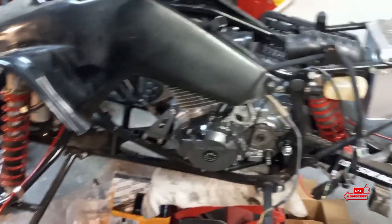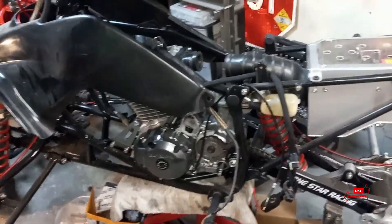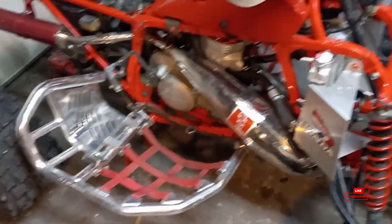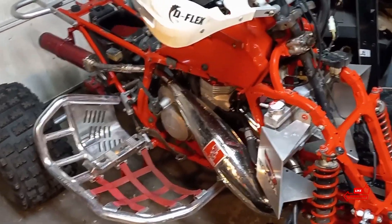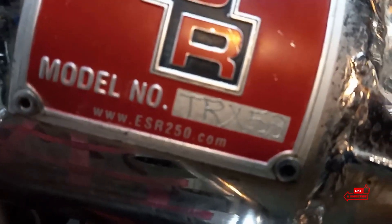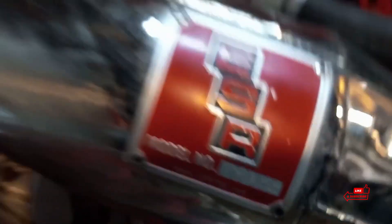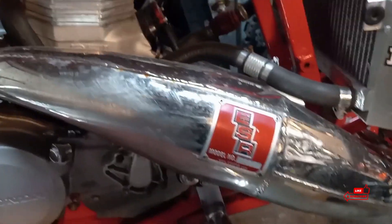To get up to the prelude of talking about my plans with this — and those are just the plastics sitting on there — before we talk about what I want to say about the 465, let's talk about the 250R. I just got this about two weeks ago. It's a 1986 Honda TRX 250R. It has a PSI 330 kit on it with a PWK carb. I believe it's a 38mm ESR TRX-5 pipe, TRX-5B. It also has an ESR silencer on it and a Uni filter.